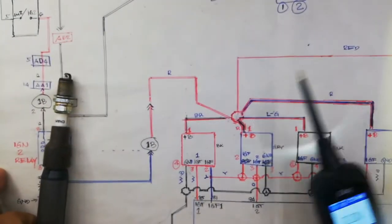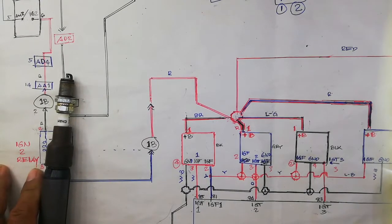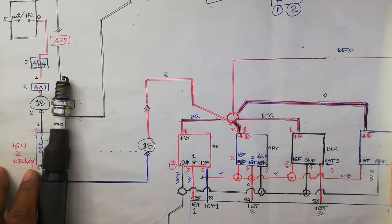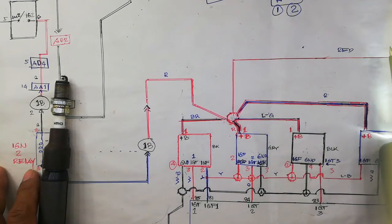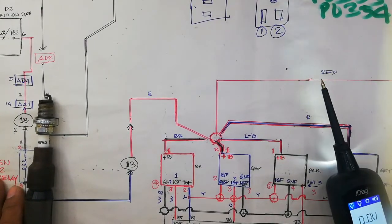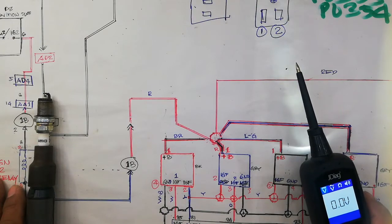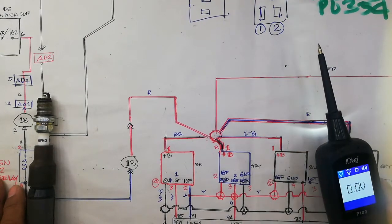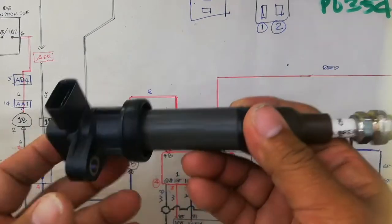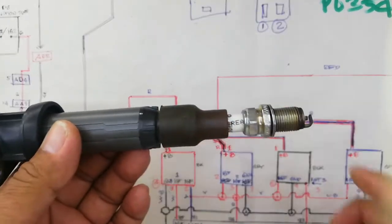This is the circuit diagram of Toyota Yaris 2007, 2008, 2009, and 2010. Remember, if the engine cranks but does not start and your fuel pump pressure is okay, injector system is okay, computer is okay, crankshaft sensor and camshaft sensor are all fine — but the issue is the four ignition coils have no spark.